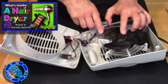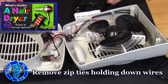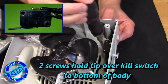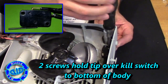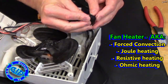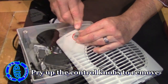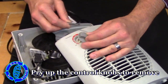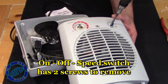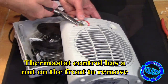In a previous video, I took apart a hair dryer to show you what was inside of that, and you may note that the parts inside of each of these are very similar. The only difference is this heater has them on a slightly larger scale. Just like the hair dryer, this heater works by a process of forced convection, which is basically running electricity through a coil, and the resistance in that coil causes it to heat up and glow hot. You blow a fan across that, it forces the hot air out, and you can use it to either heat something up or dry your hair.